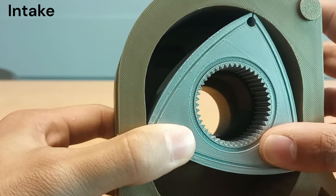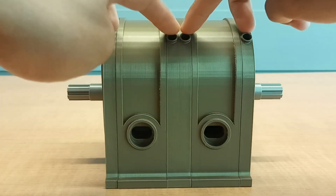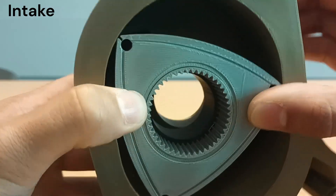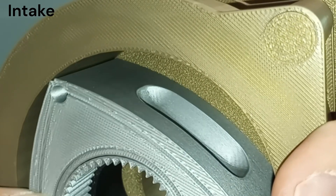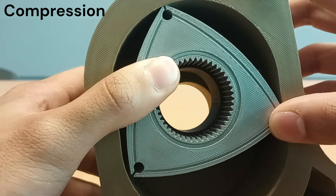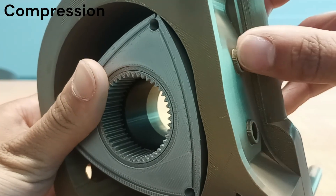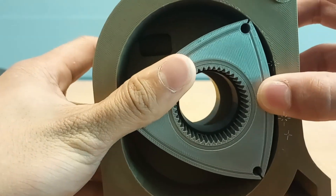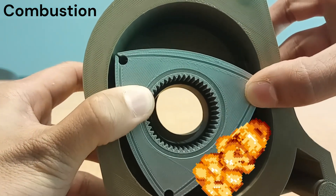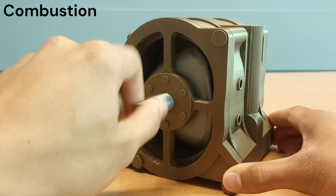The intake phase is when the rotor expands a small area into a larger volume, which creates a vacuum that sucks in the air fuel mixture from the outside through the intake ports and into the system. When the rotor has rotated far enough, allowing enough air fuel mixture in, it blocks off the intake port. Then the compression phase begins, where all of that air fuel mixture is squeezed into a small volume on the right. That mixture is conveniently placed right next to the spark plugs, which send an electrical shock to ignite the fuel. The combustion phase then begins, with the ignition using the force of pressure to push the rotor across the bottom portion, causing drive on the eccentric shaft so that it can spin in a fast motion.